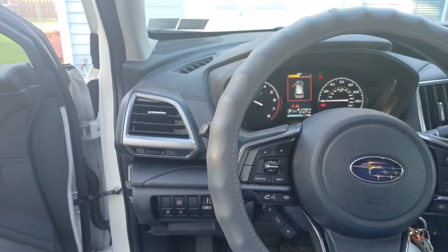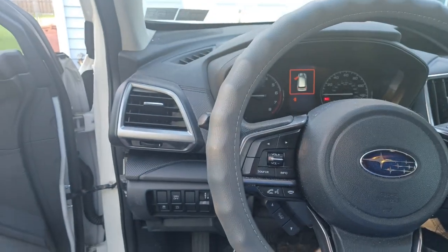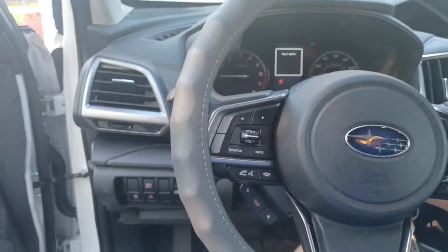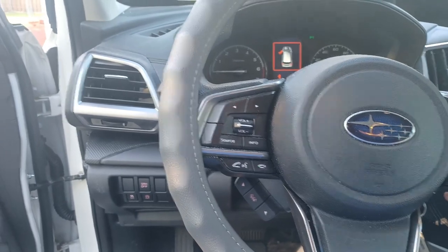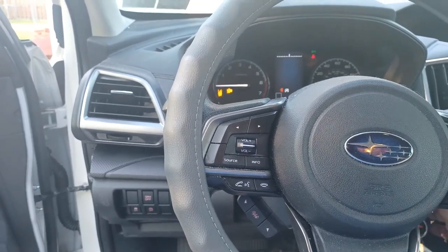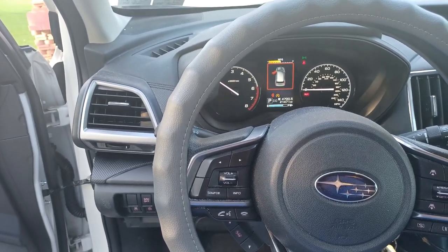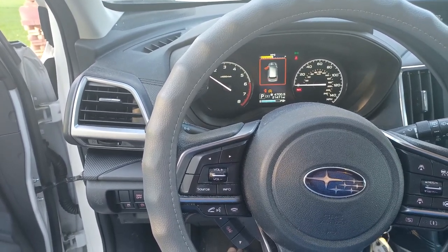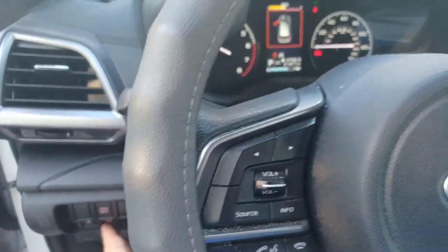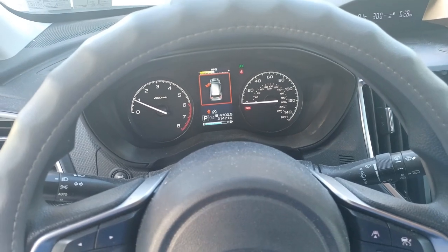Just to show that there's no trickery, I'm going to shut it off again. Here's the key — as you can see, the key has been inserted in the ignition. In the lower left corner, you can see the A-off button and I'm nowhere near it. Start the car — and if we watch... there it goes. Auto start has been disabled. And if we go down here and press the A-off button — A off — the auto start has been re-enabled. It's confusingly labeled with a slash through the A.